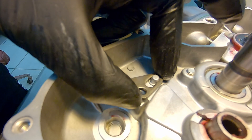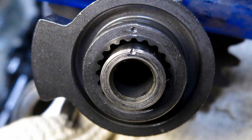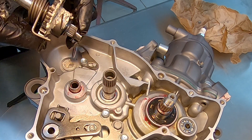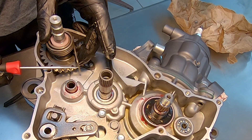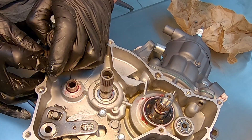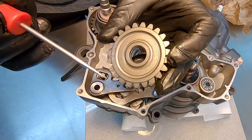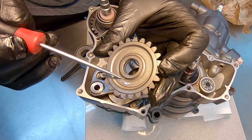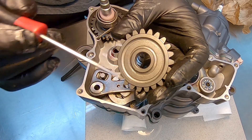The kickstart ratchet plate also needs thread locker. If you disassemble your kickstart, you need to align the spline with the ratcheting device as shown - the book has a terrible image of that. Now about the little pink sleeve: you've got to have it all the way down before you install the spring. An incorrect installation here will prevent the clutch cover case from going down. This idler gear has two channels on the front side and is smooth on the back - the correct orientation is with the two channels facing up.